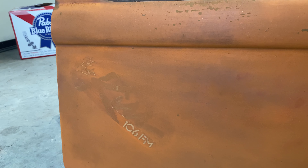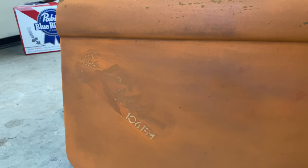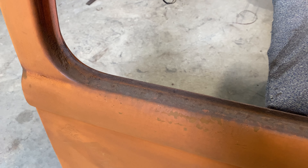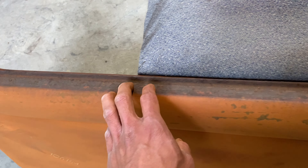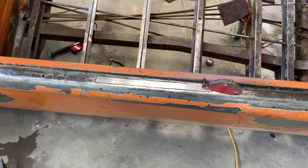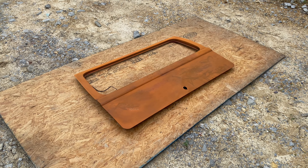I am a bit worried about this spot here, because whenever there was a decal on paint, paint stripper doesn't tend to work well on it — I don't know if that's because of a residue it leaves behind. The window sill area is also rusted, so in a future episode you're going to see me repair that, done the same way I did it on the side window. But for now, let's get that paint stripper on there.